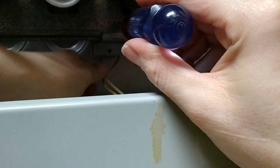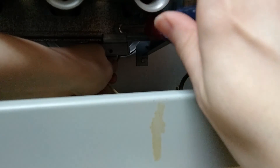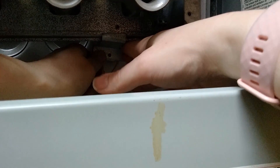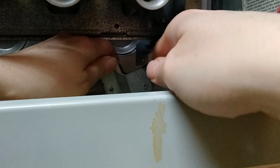I was joking with my colleagues that I'd probably end up breaking this while showing you how to do it. Use extreme caution when moving igniters — you're near electrical components, so make sure everything is off. It's good to have a magnetic hex driver so the screw doesn't fall somewhere you don't want it. Keep both hands steady — these are very delicate — and carefully maneuver the igniter out, watching that it doesn't bump against anything.